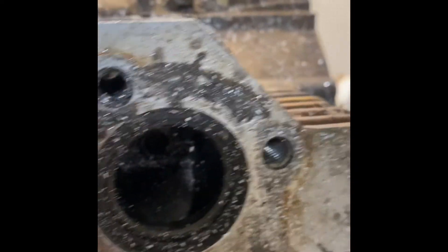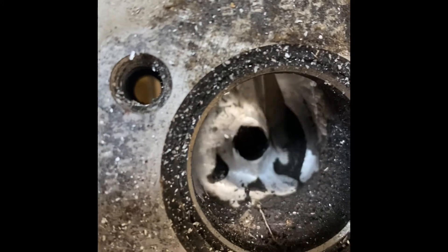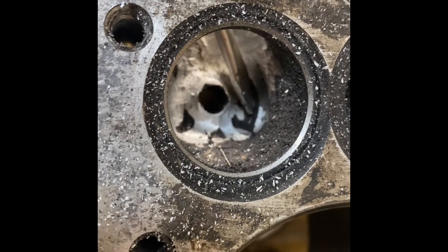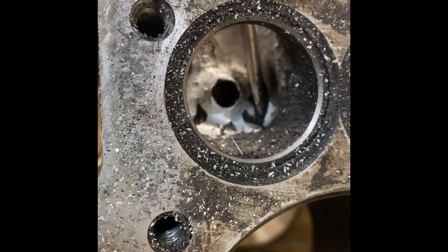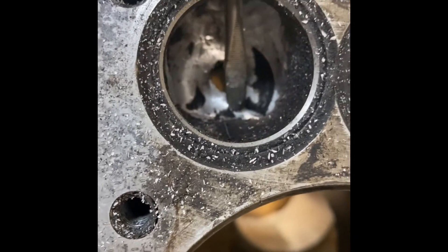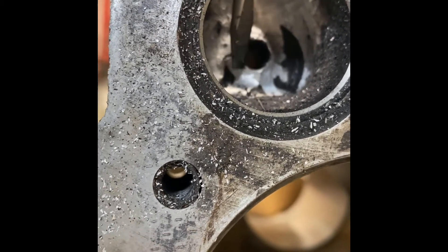So we went ahead and narrowed up that valve guide boss — remember this is just roughed in. You can see that's nice and smooth through here now. Here's the spot I'm talking about: I can't get the cutter all the way down in there because it's really starting to take a lot of material out, and we don't want to break through the guide side or break through the port. A little spot like that, we have no choice — leave it alone. Same thing back here: this area is directly behind the valve stem, which is also a restriction. We'll get into that later. Don't worry too much about this back here; just bring that around, smooth it out, and you're fine.